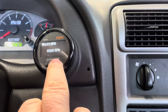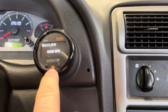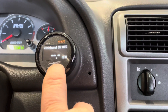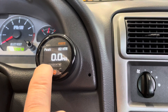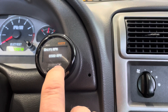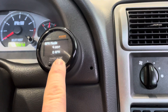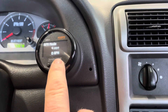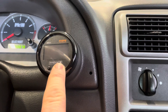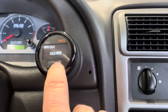Shift RPM — I set that at 6,500 RPM. That's for the shift light down here. Mine's not going to work yet until I get a tach module, which I've got coming. RPM mode — I think that's for whether you're running a 2, 4, 6, or 8 cylinder car. I haven't got that set up yet. It works more in conjunction with the shift light. You've only got about 15 seconds before it times out if you don't touch any buttons.